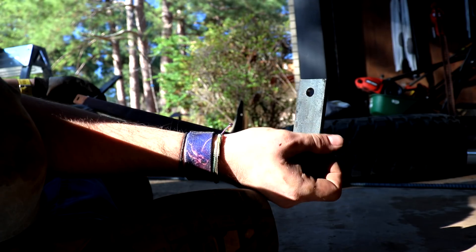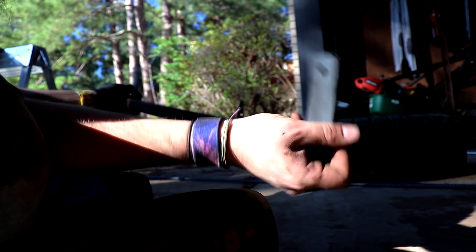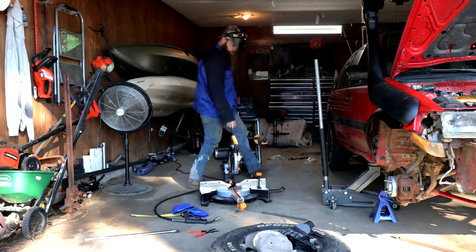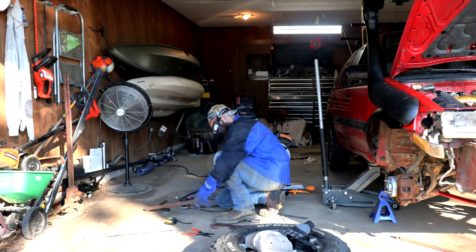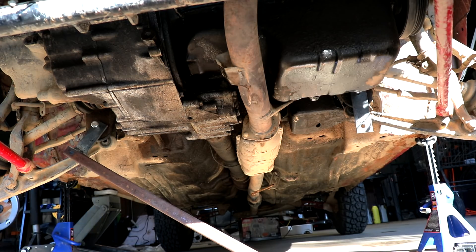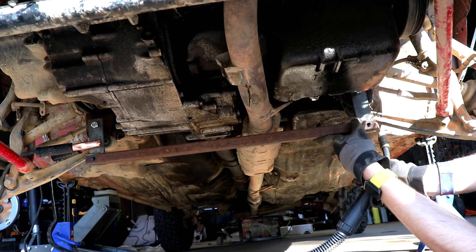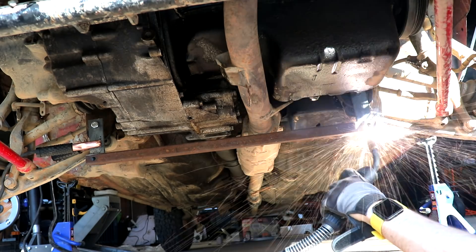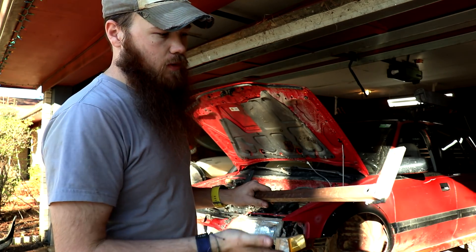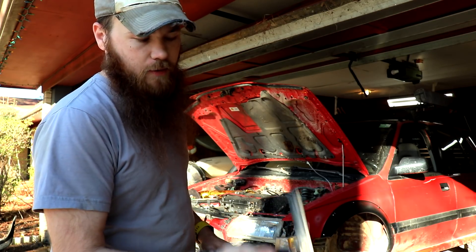So now I'm going to get ready to weld this up. I'm not going to do a finished weld — I'm just going to tack these on pretty decently so they'll keep their shape and orientation. These top bolts will be where it actually bolts to the lower control arm bolts and that'll be the back mount of the skid plate itself. I'm going to loosely bolt it into the lower control arms, hang it in there, put my cardboard template back up there, and then decide where to cut my plate. I'm going to oversize the plate a little bit so I can get ready to weld it on.